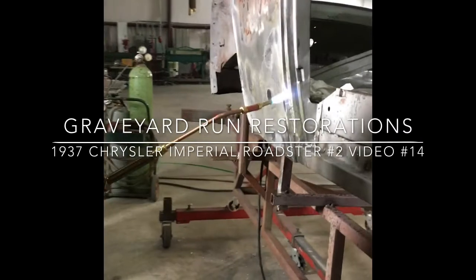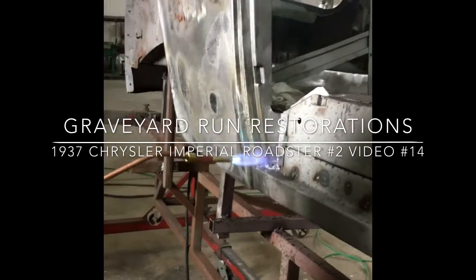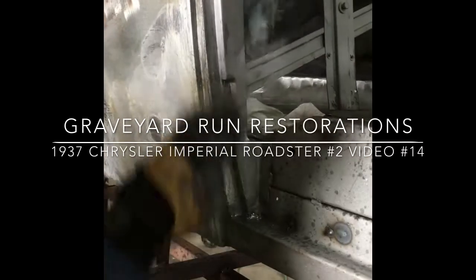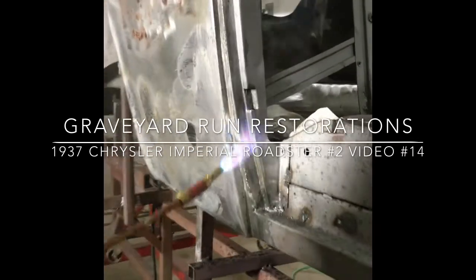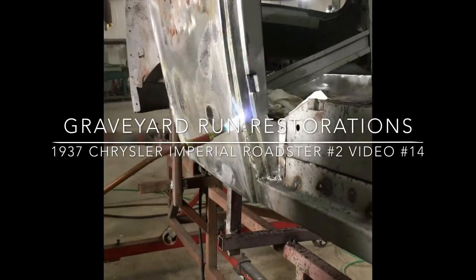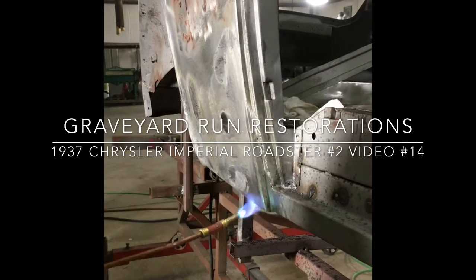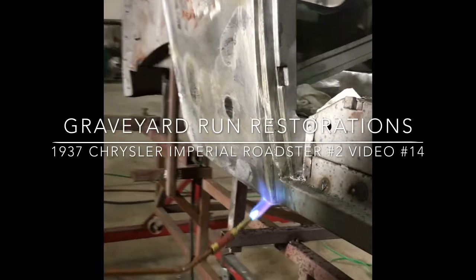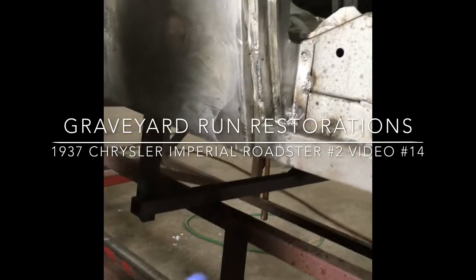Right now I'm just putting tinning butter on all the metal and seams and getting all of it acid etched and cleaned. It's all been rubbed, cleaned, acid washed, and then cleaned with lacquer and rubbed down really good before I started. And I'm doing all my tinning butters and getting all my areas attached. And then I'll clean it and neutralize everything and start doing my leading.